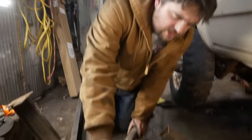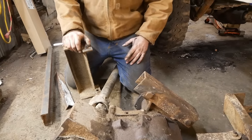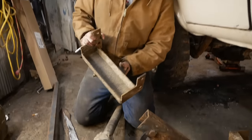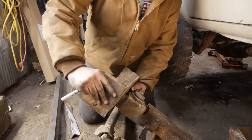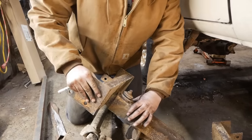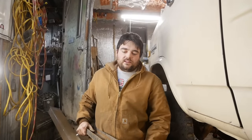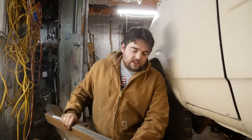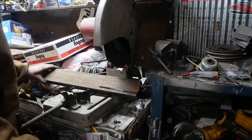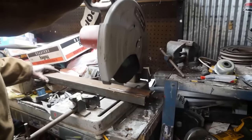Here's our transfer case. When I pulled it out, I couldn't get these bolts out of these bushings. Not knowing what kind of bushing I need to buy, I decided to just chop the crossmember into two chunks like this. I figured it'd be easier just to re-weld this back together. I don't think we can just butt-weld that together - we'll put this piece of channel in there on either side of it, weld that in, and that'll be strong enough. I managed to rip up the side of this trying to cut the sides off - we can get a flat piece out of this piece of C-channel, because that's just the kind of high-class operation I run.